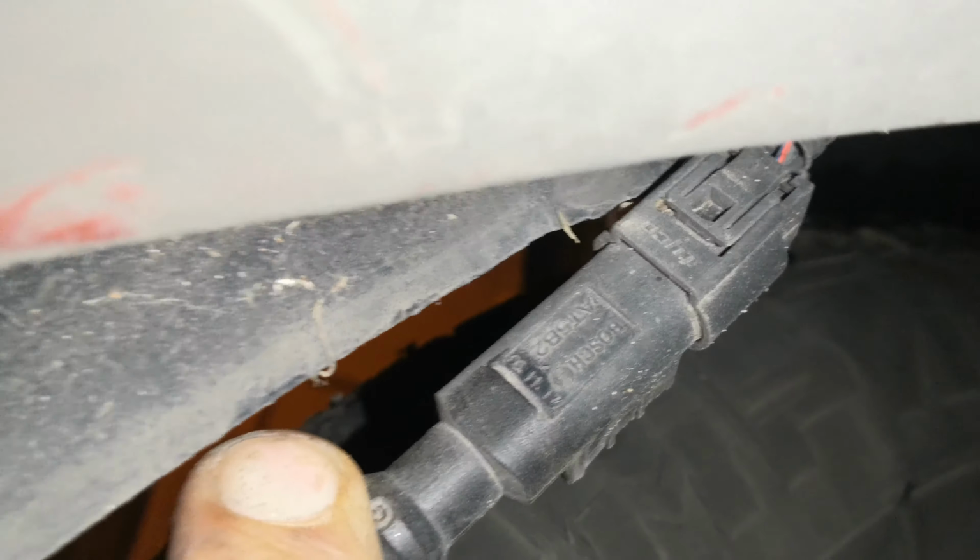So the rear brakes freewheel way too much. They need an adjustment. However, will the customer go for it? Dunno. Not really that fussed, that is their choice, but I would definitely recommend that they adjust these rear brakes. That is all we have for the Vauxhall Corsa tonight.